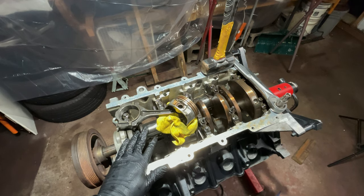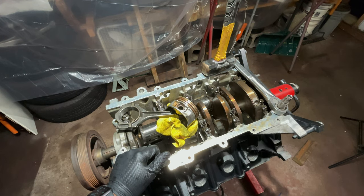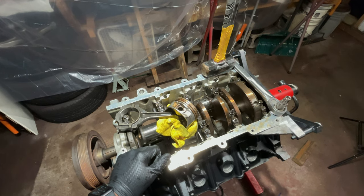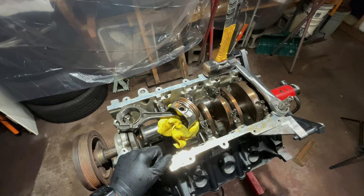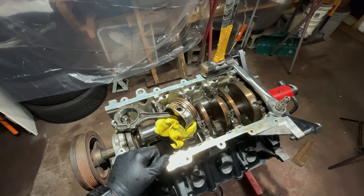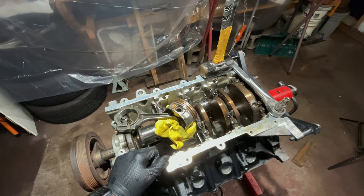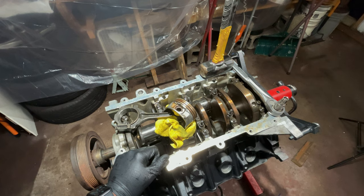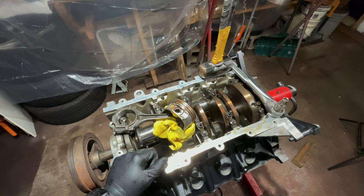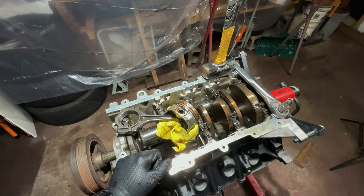Now, I'm kind of curious to check that thrust washer. I think that might be the only issue we have with the crank as far as it being out of clearance, but we'll see. So you guys have to hang around and come back when I drop that next video, when I pull off these mains and we go over what's going on a little bit deeper with this motor. So tell me what you guys think. I hear you screaming at me like, oh, you're already here, you got everything out, just forge it out. But I'm sorry guys, this isn't that kind of build for this car.